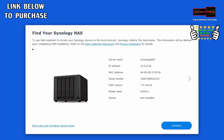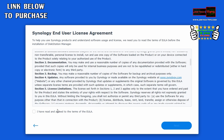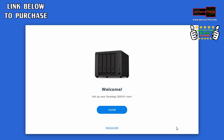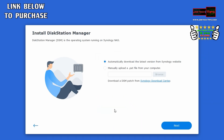You need to go to find.synology.com to find your NAS as soon as you plug it in. It's silly easy — as you can see it found the Synology right away and we're going to connect to it. I'm going to agree to the EULA and continue. Now it says 'Set up your Synology DS923 Plus.' We can look at device information — it's not installed yet, so when we hit install it'll automatically download the latest version from the Synology website.